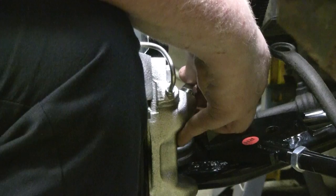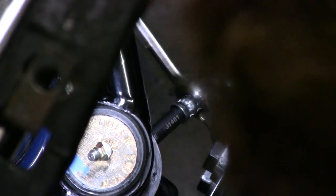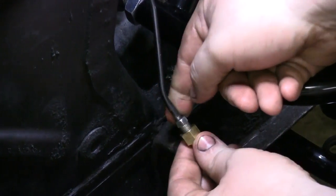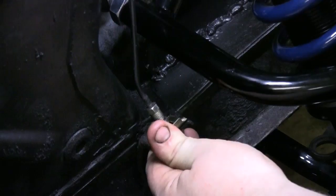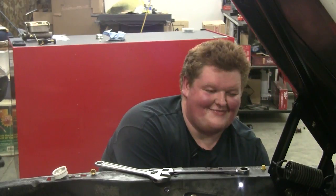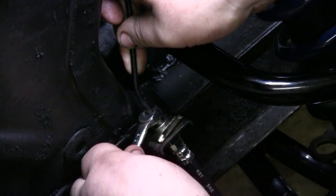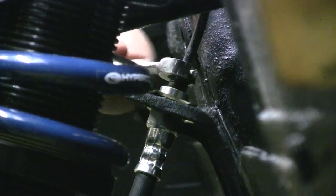Now that one's in. The caliper is slightly off center but the pad isn't touching the other side. We did have to shim but this side might be able to get away without doing that. If you need to, what we did was just put a thin washer in between the caliper and the caliper mounting bracket — it moves the caliper in towards the inner fender, so that is how we cleared that gap up. Next up is your brake line. Do not forget this copper washer in between the caliper and the line — it's what seals the line to the caliper. They send brass fittings that convert from different diameter brake lines. This one fits like a hot dog down a hallway, so we do not need the brass that came with it. Install it straight on, install the clip. It's always good to use line wrenches on fittings so you do not splay the wrench and strip them — because then you'd have to cut the line and make two lines.